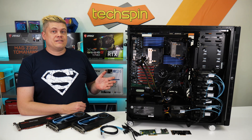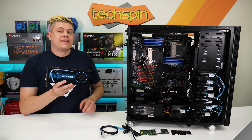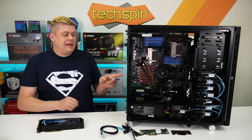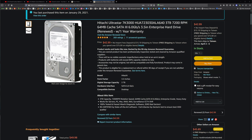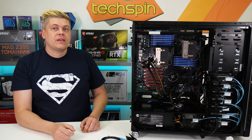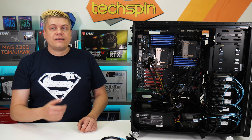This would have cost $5000 in 2010 money — parted out maybe around $1200 — and we got it for just $110. However, plugging in the graphics card, we actually lost use of PCIe slots 3 and 4, and I couldn't get them working again in BIOS either. Slots further down had no issues, and there was no trouble with the NVMe and LSI SAS cards. From Amazon we got 3 HGST 4TB and 5 HGST 3TB NAS drives, all refurbished — and we don't recommend them. A huge time-saving tip: add the last 4 digits of the serial number on electrical tape to the drive bay. Since Unraid lists drives by serial number, this saves a lot of time troubleshooting drives with SMART errors, overheating, and wiring issues.